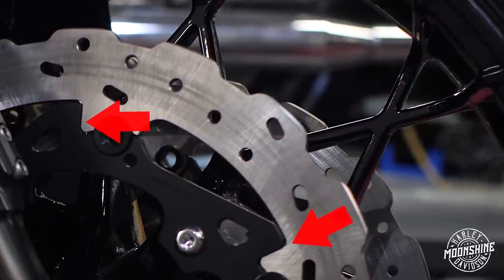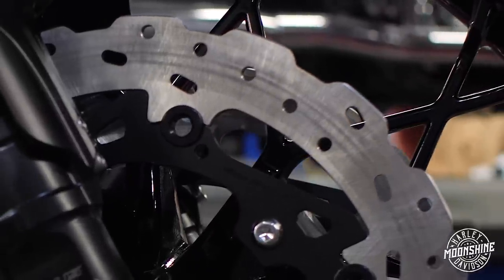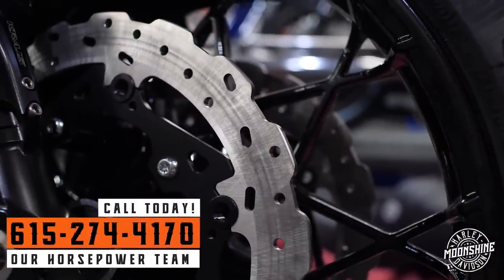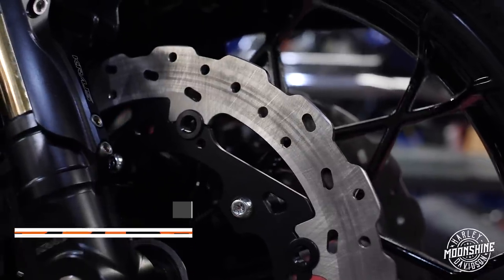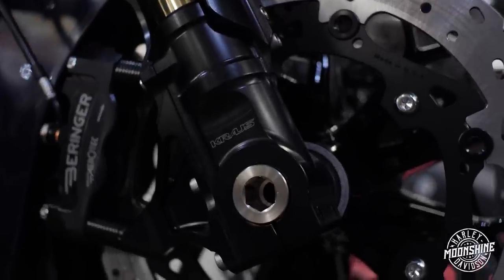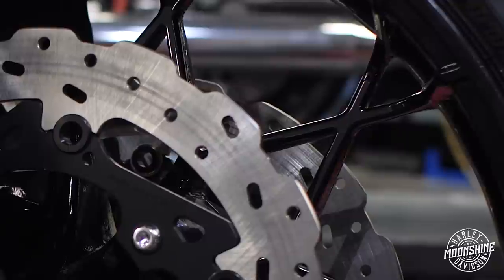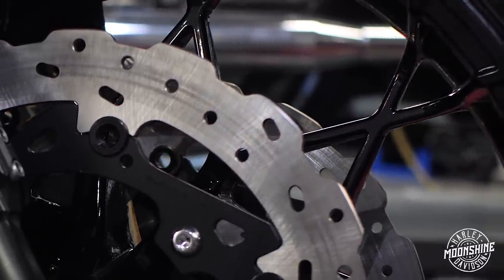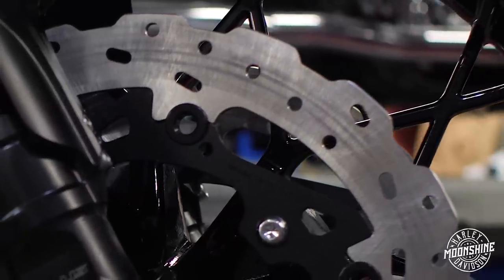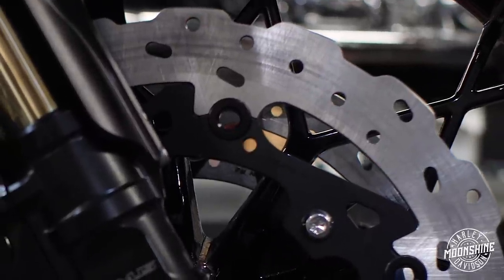That flat-stop design takes the load between the two pieces instead of on the bobbins. We've seen other brake manufacturers where the load is on the bobbins — the inner carrier gets worn because it's a round surface on a round surface, and it rounds off that top corner. As you get mileage it gets looser and looser. Some other manufacturers put more bobbins — 10 or even 12 — which hold the carrier and blade better, but these six-bobbin rotors are lighter because less mass means reduced rotating weight. Reducing rotating mass is part of performance bagger.